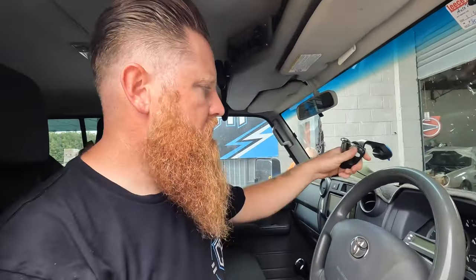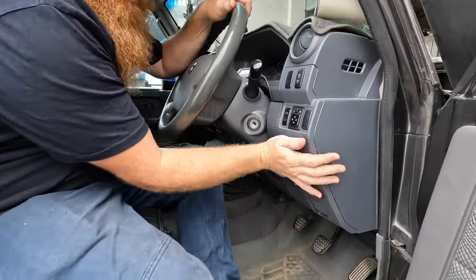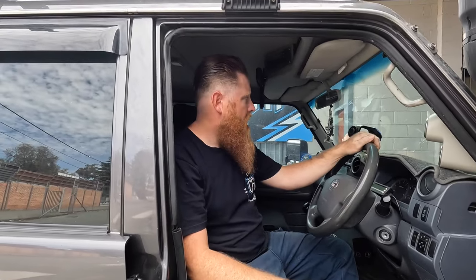Why are we replacing these speakers? We've covered this before on our channel — if you go back and look at our 79 Series video where we did a full stereo system upgrade and soundproofing. Long story short, 79 Series cruisers are great value for money, but you get these enormous four-inch speakers in the dash. When you're driving, especially on the phone — if you're someone who's on the phone a lot like a builder — basically you can't hear anything. Putting a decent six or six-and-a-half inch speaker in the front will make a significant difference to the sound, no question.